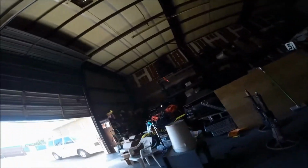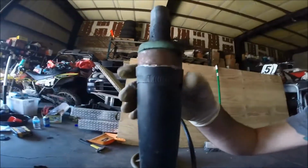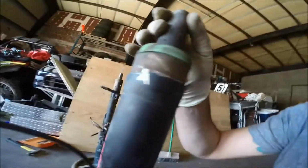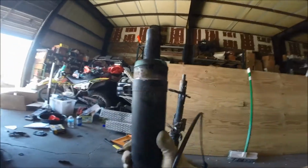And then we'll take the shroud off of the YJ one. This little shroud, being that it's removable, you know, it's got two bolts here, it should come off, and then after we mount it, we'll just put it on and get it done. Actually, halfway through, I figured that you can just cut around here as long as you don't go too far, and you won't damage it, and you'll just cut all that lip off, and that'll be an easy, clean way of doing it. Now let's go to try to fit it in the vehicle.